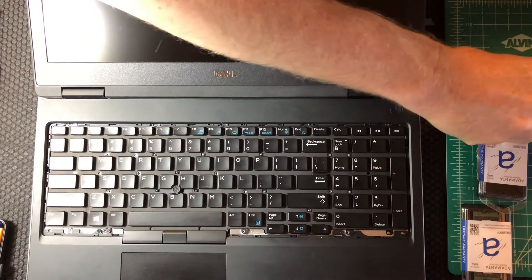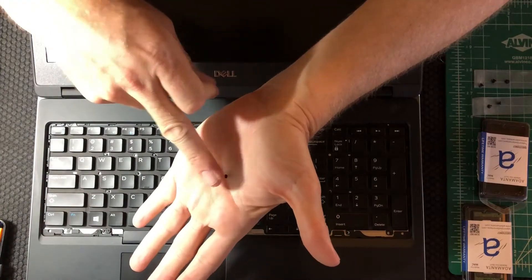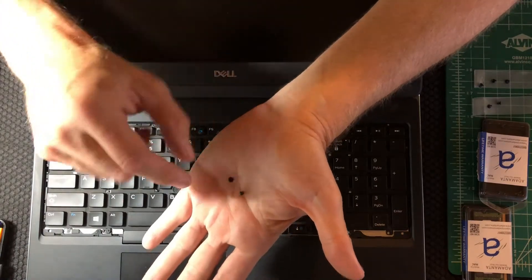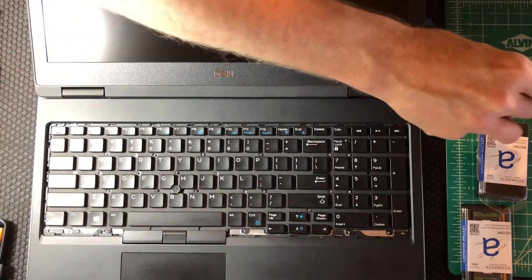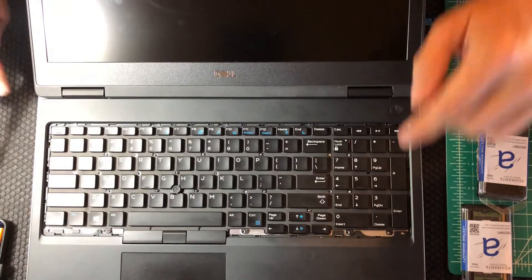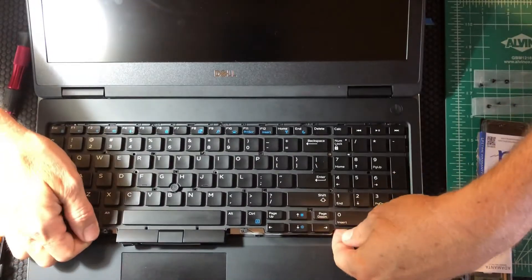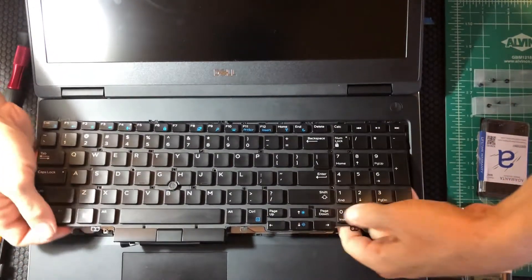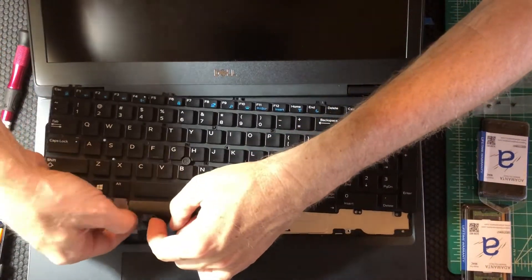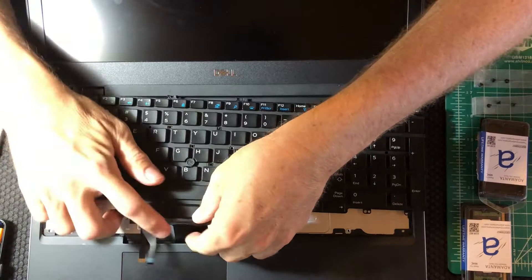Notice that these screws are not the same — the screw across the bottom of the keyboard is very small, and the screws in the center have a larger head and longer shaft. I keep them separate using tape so I don't lose track of where they are. Once they're all removed, the keyboard lifts out from the bottom and you can feel the ribbons that were removed from the other side releasing. Work them out very carefully one at a time — you don't want to damage those connectors. The wide one is definitely the most difficult to get out.